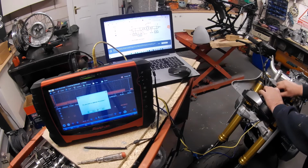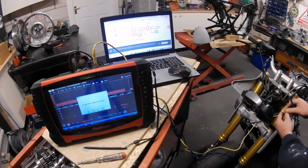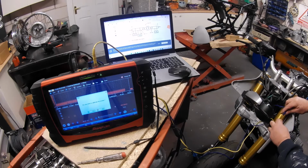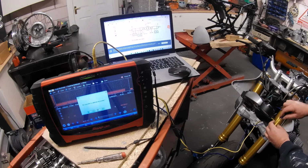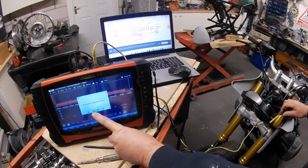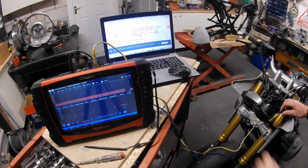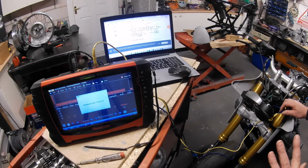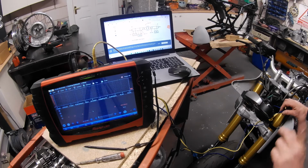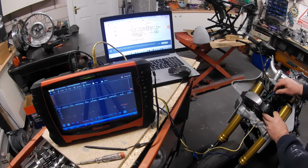What I'm going to do is take the wire out the back and join the probes. The probe is essentially our back probe. So as you can see, I connect channel 3 and 4 together, which I've done. It's now calibrating to 0. Okay, so now the reading we get is going to be accurate. So I'm just going to put that one back in there.